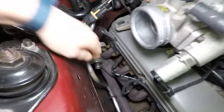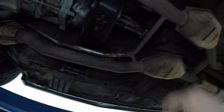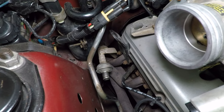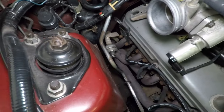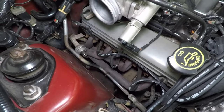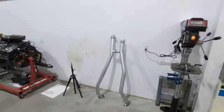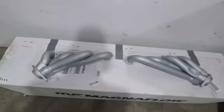The last piece of this puzzle is this hose right here, which goes down into your H-pipe. I've got to get underneath the car and pull that out, but it may well come out with the H-pipe since there's a really goofy hose clamp on it that's hard to get loose. So I think I'm going to cut this video off here — the following video will cover removing all the stock exhaust and putting on the aftermarket stuff: the BBK H-pipe with O2 bungs welded in, and the BBK unequal length shorties.